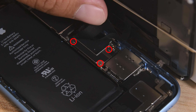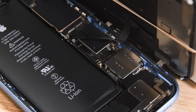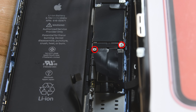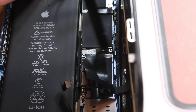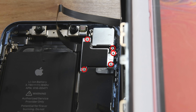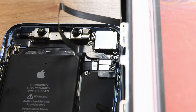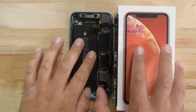Use your Y000 bit to remove the three screws securing the battery connector in place, then use tweezers to remove the bracket. With the pointy tip of your spudger or a clean fingernail, pry the battery connector up and away from its socket on the logic board. Keep your Y000 in hand and remove the two screws holding down the display connector bracket, then use your tweezers to remove the bracket. Disconnect the digitizer and display cable connectors with your spudger or fingernail. Now remove the five screws securing the logic board connector bracket — two are Philips 000 and three are Y000. Remove those and the bracket, then use a spudger or clean fingernail to disconnect the front sensor assembly connector. With that done, the display is free.